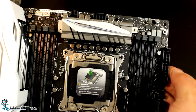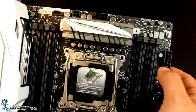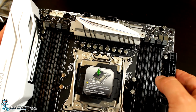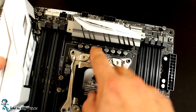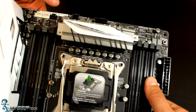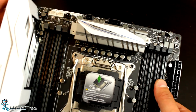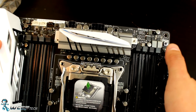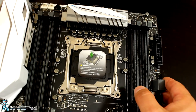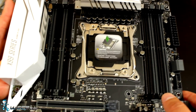Starting at the top, you've got an 8-pin and a 4-pin for the CPU. The second 4-pin is optional — I'll be using it because the power supply supports it. You do have a nice metal heatsink on the VRMs, and there's a pump header and two fan headers for the processor, which is nice. The MemOK button is over here on the side, and you've got the LGA 2011-3 socket with the quad-channel setup for eight DIMMs on either side.